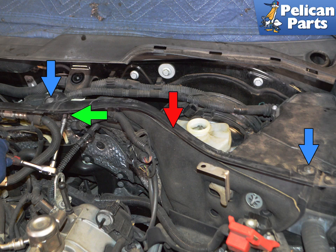There is a cross panel covering the brake fluid system. Unscrew the two T30 Torx screws along the top and the one T30 Torx screw holding the cross panel. When reinstalling, you will need to tighten this to 14 newton meters or 10 foot pounds.